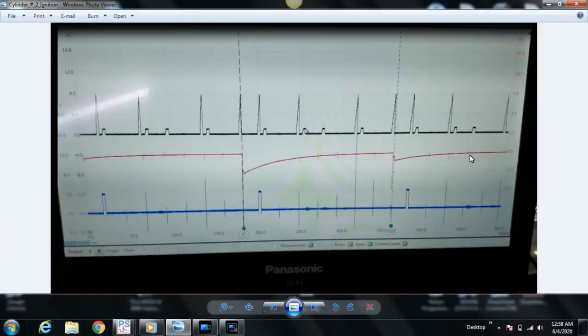Okay, we decided to do a voiceover at this section because there's a couple of missed opportunities that we wanted to take care of. One thing is we didn't mention the obvious thing, which you guys have probably picked up on, is the engine noise. You could hear that the engine is running rough, but you could also hear some engine noise at this point. One thing I wanted to bring up here is with hybrids, for any misfire, whatever the cause of the misfire, it's not uncommon at all for the engine to sound like it has catastrophic internal damage. At least on the vehicles that we're familiar with, which is Priuses or other vehicle manufacturers that are modeled after the Prius hybrid system.